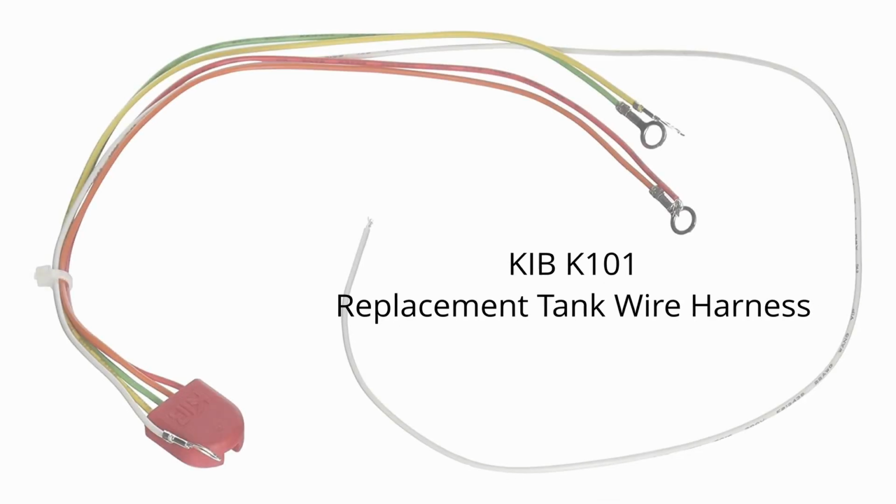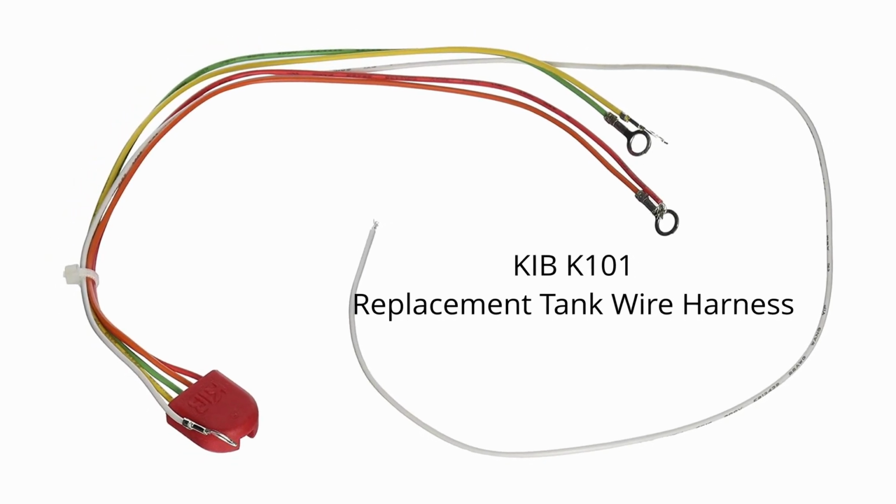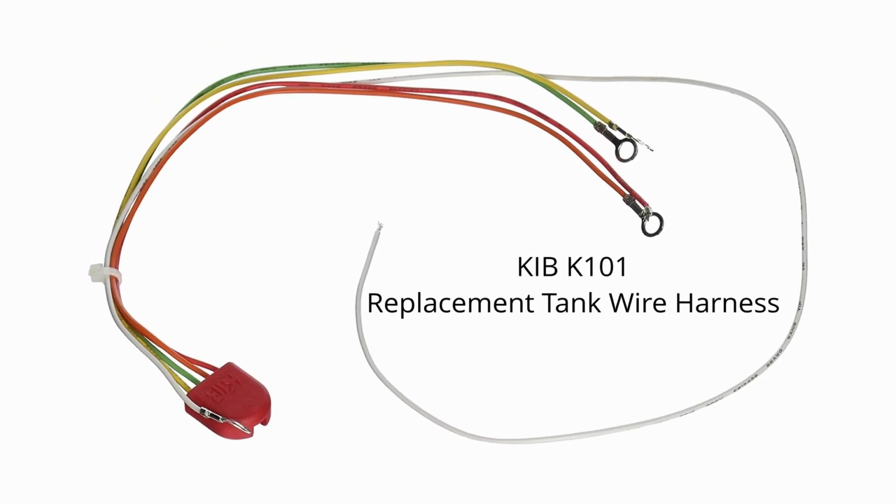So how they get their information up to the top is the K101 Pigtail. That resistor pigtail has different signals. When water reaches the sensor, it makes the resistor inside there send a particular signal. And each time water reaches the next sensor, it activates the next one. So all 3 signals go up that wire at the same time.